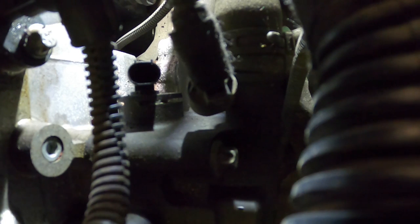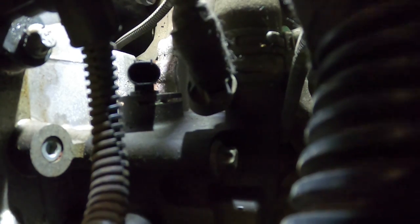Right, next job, all the coolant's now out. It's definitely drained out, it's now just a couple of drips. So we're going to quickly whip this sensor out. All right, so that's the sensor there. First of all, we're going to pop this clip out, which is over the top, here. I'm going to get my long nose pliers to make life a little easier. Get in there, get over that clip and straight up, out that clip comes, see that? Clip's now out. And then, like I said, we're going to pull this sensor out. I'm going to try and get my hands in there.